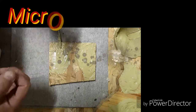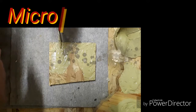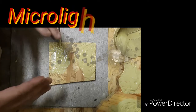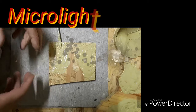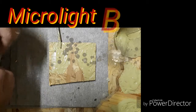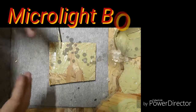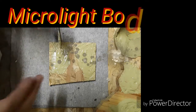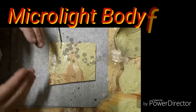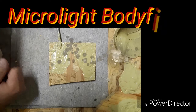It comes as a paste, you put in your order, same story, different amount of drops, and you basically just work it over the area where you want to put it. Bear in mind, when you're using the strand with the resin with the body filler, it becomes stone hard. You're gonna have to use a flapper disc or a grinding blade with a grinding machine to basically smooth it off, and only then can you start sanding the product.